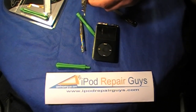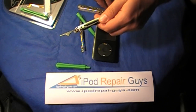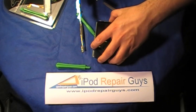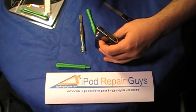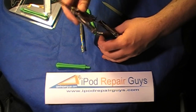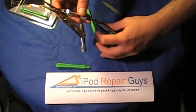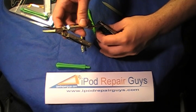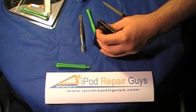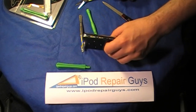I also recommend the use of small screwdrivers. They are also very helpful, although they tend to be a little bit more delicate and the tips can break. I started up near the hold button at the top and managed to slip a tool between the two halves when pressed together, and just open or separate slightly the metal case from the plastic — just enough so that I could start to work some of the other tools into the case and work eventually around the entire case.